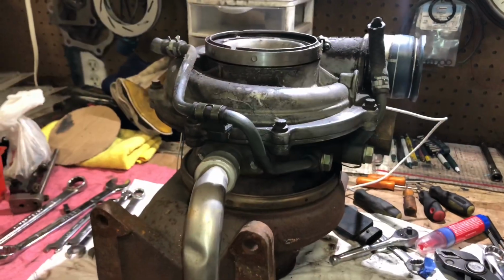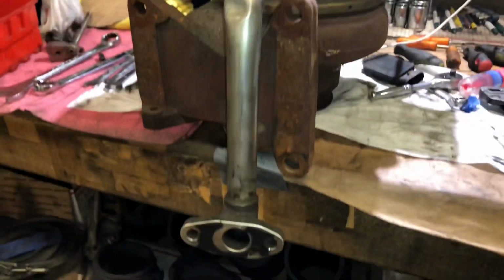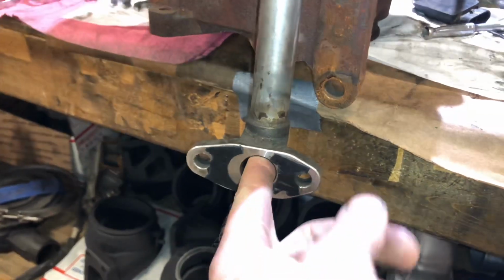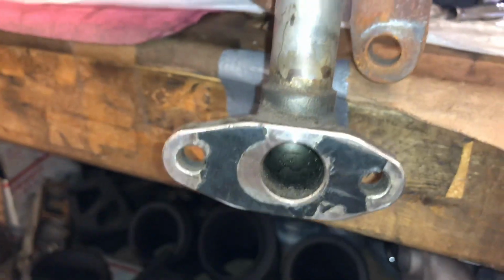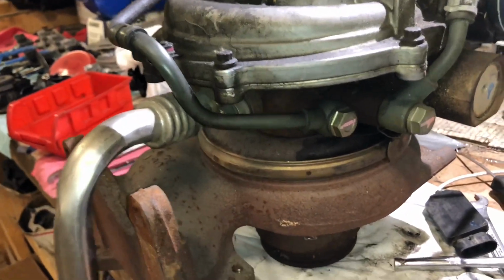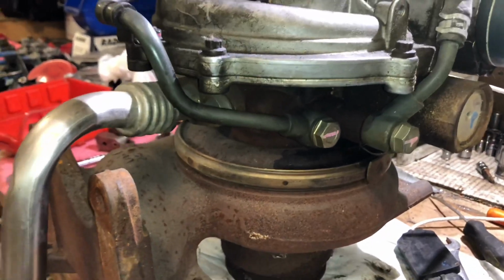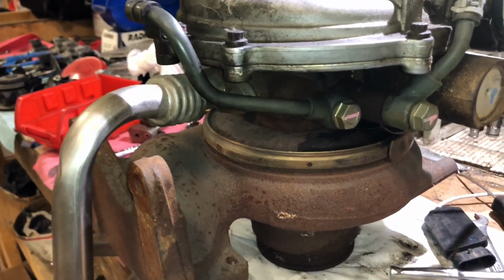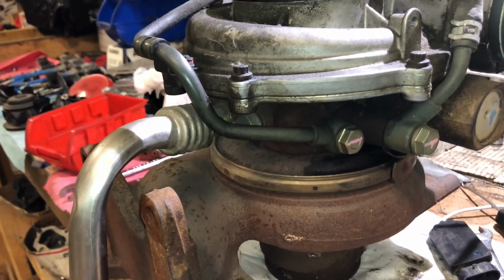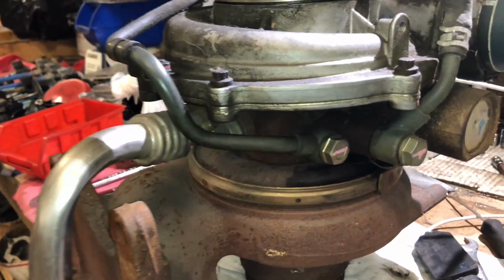Now I'm going to explain why the turbo would leak oil because the drain is too small. This is your oil drain. This is on a Duramax. You see how big that is? That one's about 20 millimeter. That's pretty common on a bigger size turbo, but these people put these aftermarket drains on here that are not on this turbo, but on aftermarket turbo setups. They're not capable of flowing enough oil through them to remove it out of the turbo.